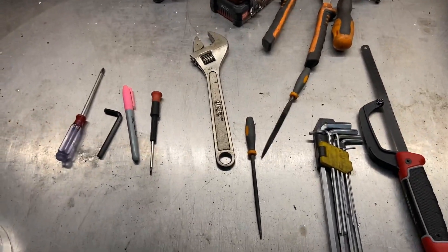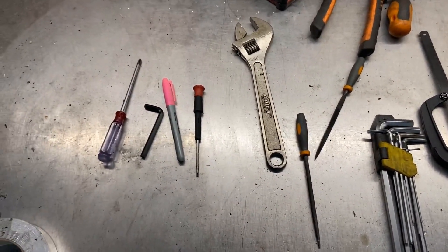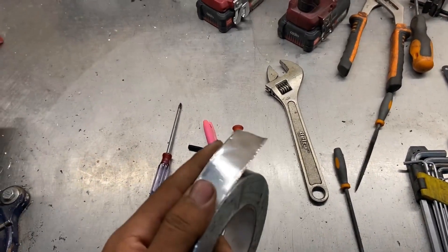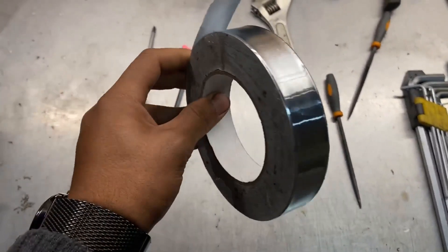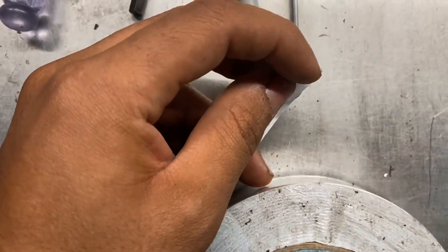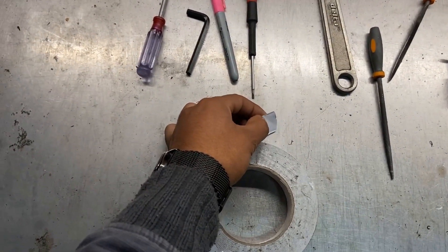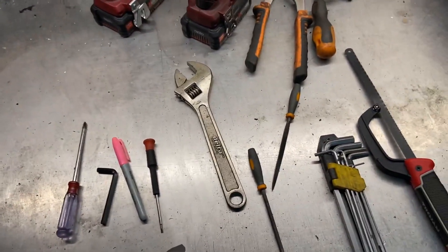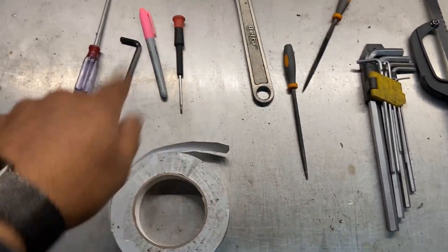The heart of this hack is how to interface between the Tesla screen and the control system — what's actually doing the pressing. That's the difficult bit. So I did some tinkering and discovered that you can use this: tin foil, or aluminium tape. It's foil on the back and if you peel that back it's actually sticky, so you can stick it onto the screen without doing any damage because it's just acrylic tape. With small pieces on, you have a region you can actually stimulate.